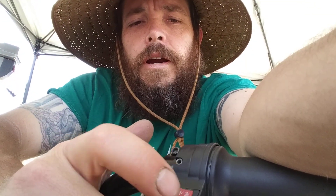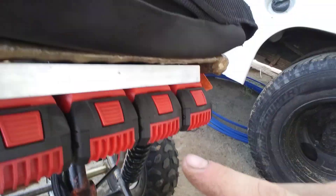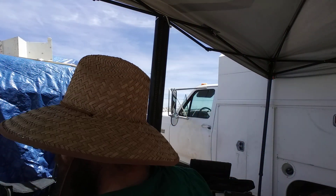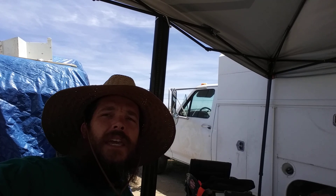Here's the switches and it seems like the fault is somewhere in here — if I give them a jiggle, sometimes it'll go and what I'm seeing is it just loses all power and dies out. I am riding it hot and fast, the motor is going crazy, and after about 20 to 30 minutes the batteries get pretty hot and want to cut out. But this issue was happening from the very beginning, so I may have already burned up or compromised the speed controller.